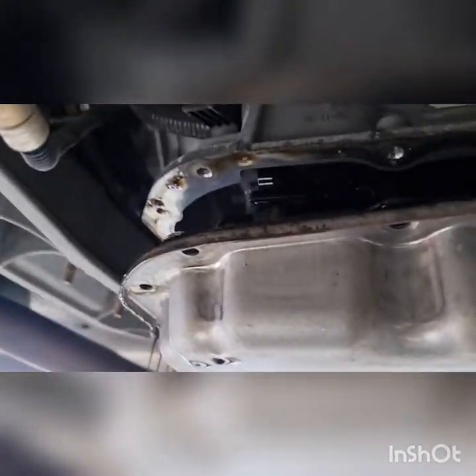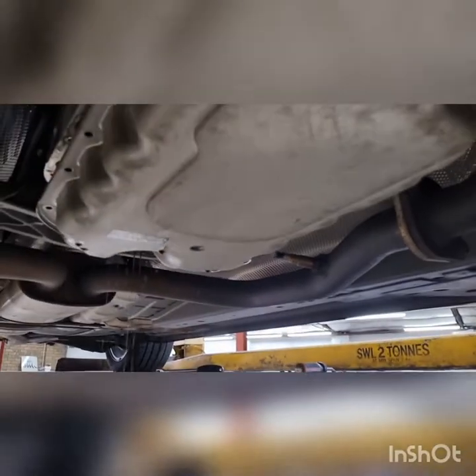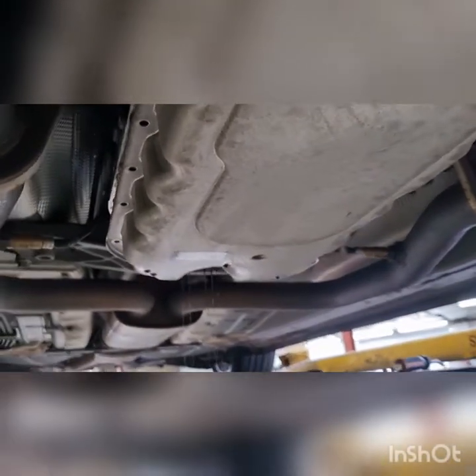I think what I will do, just to stop me from potentially spilling it, now that it's down this far, a fair amount of oil is going to be coming out, but it still will be reasonably full. I will basically push the pan up with my left hand, take the two bolts out, drop it down, tip it into the pan. So I'm going to need both hands to do that.